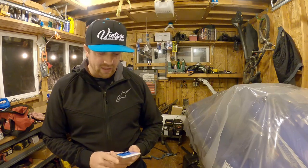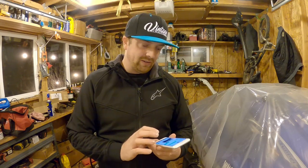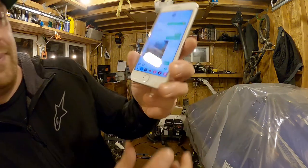Yeah, exactly. For this entire video, Jacob and myself have been operating under the assumption that the engine Jacob got is in fact a 1200 instead of a 1500, but he actually texted me later that evening and said that it was actually a 1500, because he looked it over and found a spot on the engine block where it says 1.498 liters, which would be 1498 cc's, which would make it a 1500. Here's the picture that he sent me.